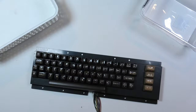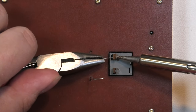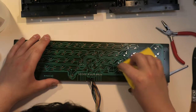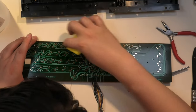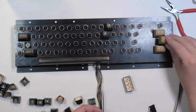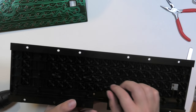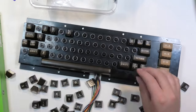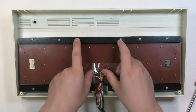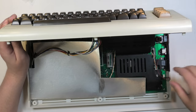The keys finished their retrobrite, so I removed them from the board to clean them off. I desoldered the shift lock key and took out the large number of screws. I cleaned the contact pads with alcohol, hoping they will make better contact with the keys so less force is needed to register a key press. I reassembled the keyboard but had a hiccup when I couldn't put a key back — I discovered the plunger was in the wrong way. So I took it apart again, made sure all plungers were correctly oriented, and put the keys back. Reconnected the shift lock, screwed it into the case, and reapplied the piece of tape.